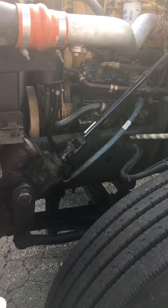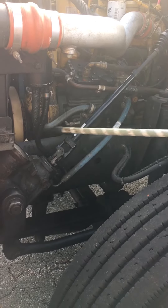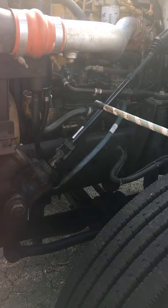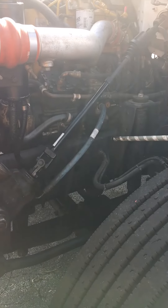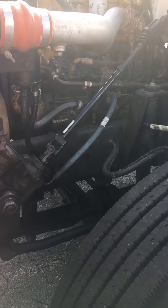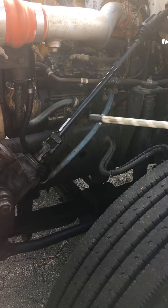Before I move to the reservoir, I've got my frame. The four parts are: longitudinal members, cross members, box, and floor. Even if I can't see the box and floor or cross members, they're testing me and not the truck. For all four parts I'm checking for cracks, holes, broken welds, and damage — four things to check for.